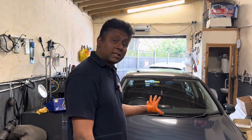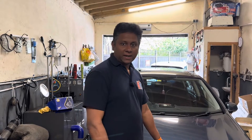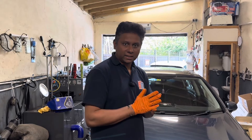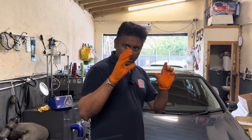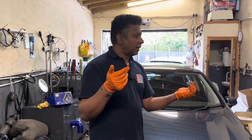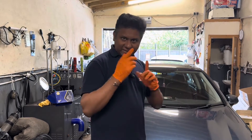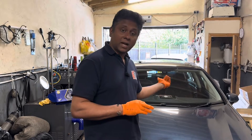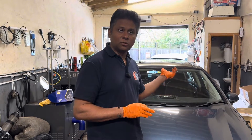This customer, while he's driving, his power steering locked, electrical started playing up, and lots of warnings appeared on the dashboard — engine management sign, airbag sign, and power steering sign. First of all, I'm going to start the car and show you what's going on.